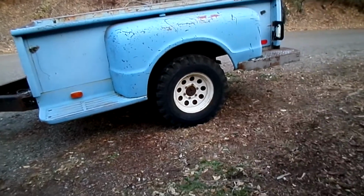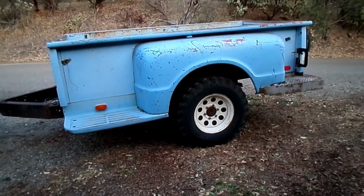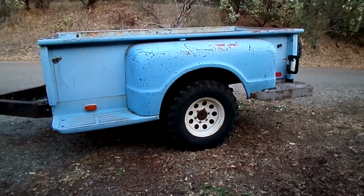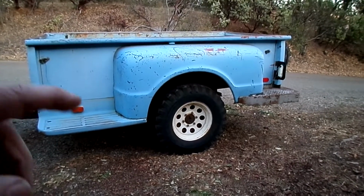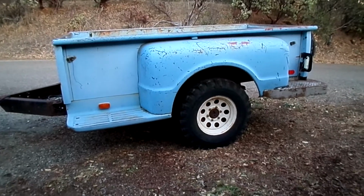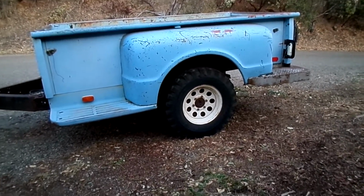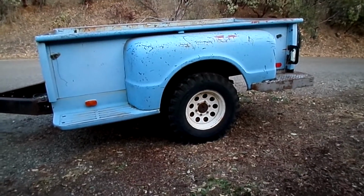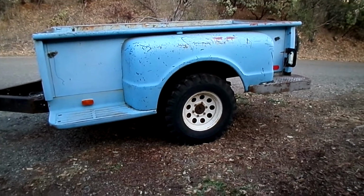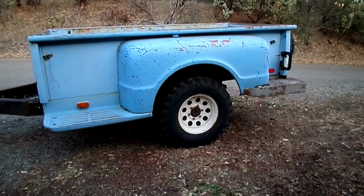So that just leaves maybe a wheel bearing seizing up. I bought this trailer in '98, checked the fluid then, and I haven't checked it since. So it's very possible it's dry. But the hubs were dead cold, both sides. The rear end still has its guts, so the ring and pinion are in there. I felt the pumpkin, and it was mildly warm, but nothing hot. And considering the miles that I hauled it, if it was dragging that whole way, which it felt like it was, something should have been hot.